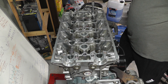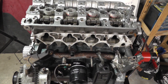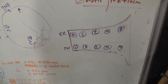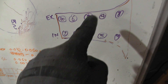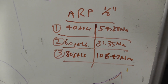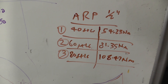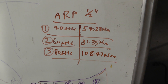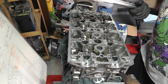Now we're into the torquing procedure. The engine is oriented with the inlet facing me, as if sitting in the car. The ARP nuts are labeled and we torque them in the sequence one through ten, in three steps. In imperial: 40 foot-pounds, then 60 foot-pounds, then 80 foot-pounds. In newton meters that's 54.23, then 81.35, then 108.47 newton meters. So you do the full sequence at 40 ft-lbs first, then repeat at 60, then again at 80.